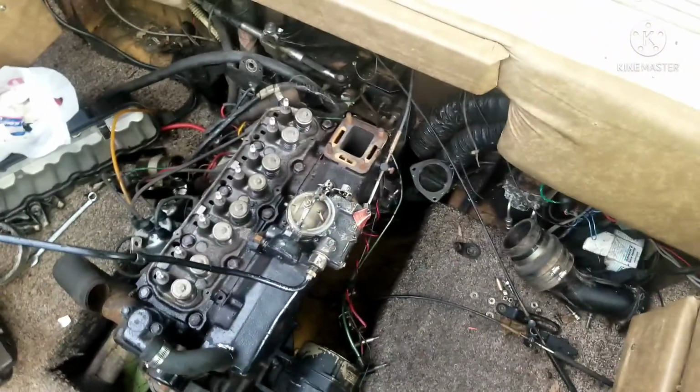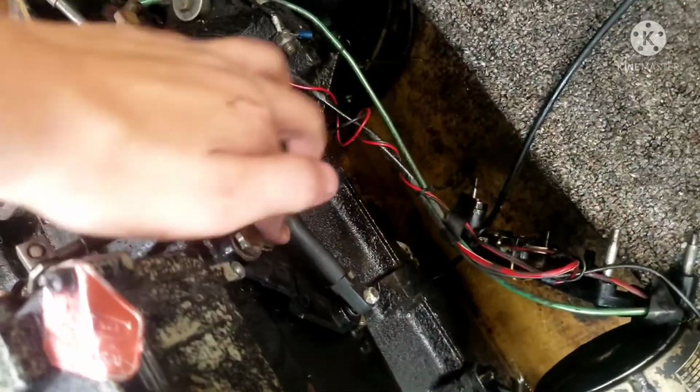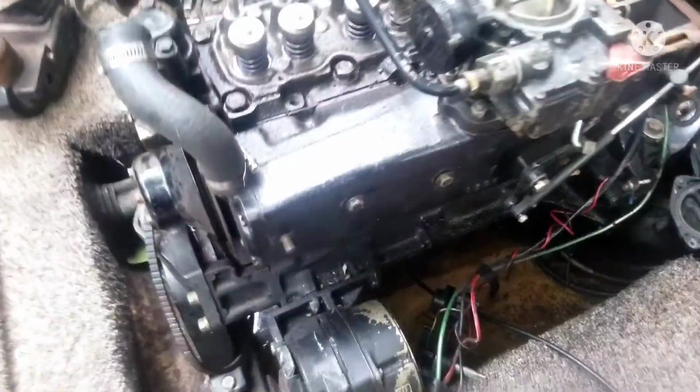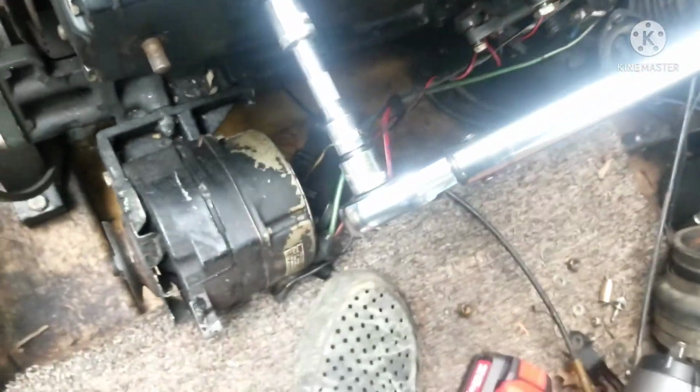And now since we're here, we can put the 4 main bolts back on this thing, which are all right here. For these bolts and that one nut, the manufacturer calls for 28 foot-pounds. So yeah, let's torque them down. There was more than I thought when it comes to mounting this thing.